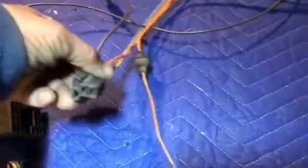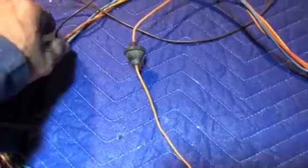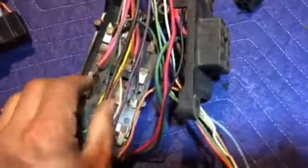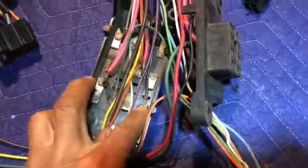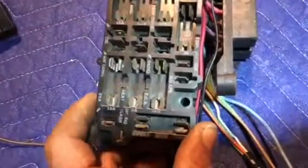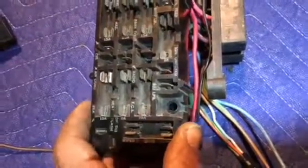You would come up to this harness connection that was attached to the heater control switch, the off and on, and then you would trace that brown wire back, and you would come into our fuse box, and that brown wire will lead you right here. Then when you flip this over and you look at the fuse box panel, you see air condition, heat, and that's where the fuse would go.